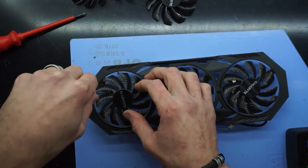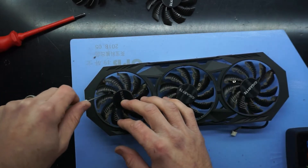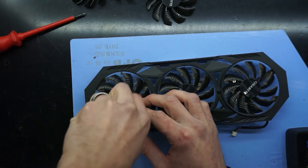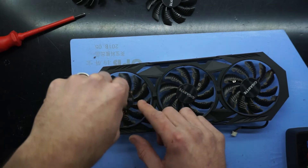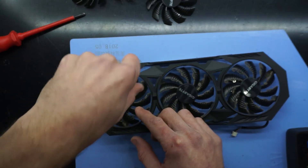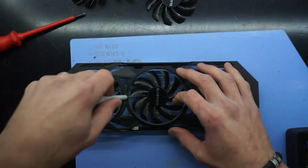I want to compare the routing of the cables, which so far should reach. These are relatively straightforward to disconnect. You should be able to use a small Phillips head screwdriver — I've got a really tiny one here, but even the red one in the top left hand corner that we used to undo the screws at the end should be usable. It just makes it a little bit more difficult when you go to put the screws back in later as you tend to hit the blades.